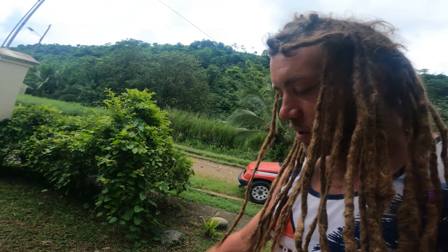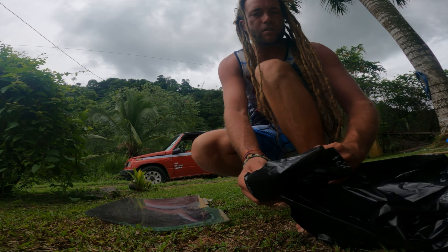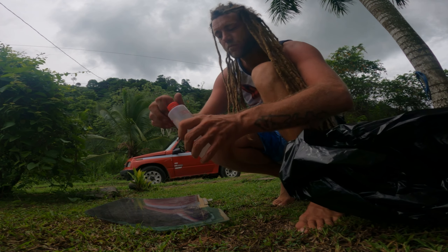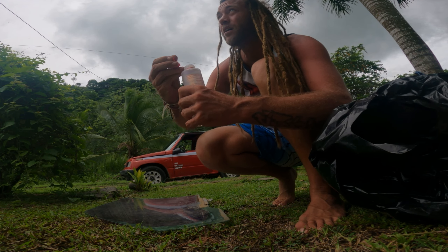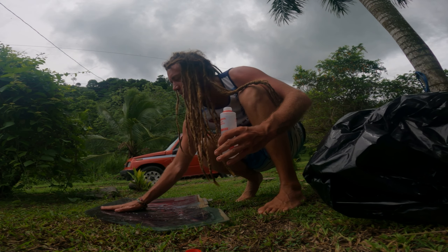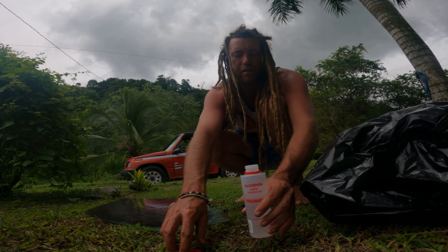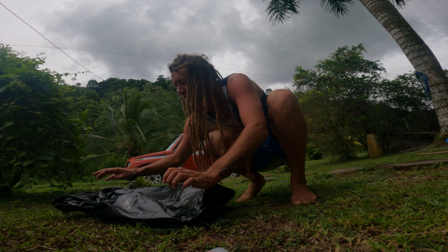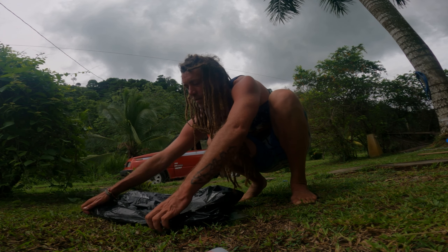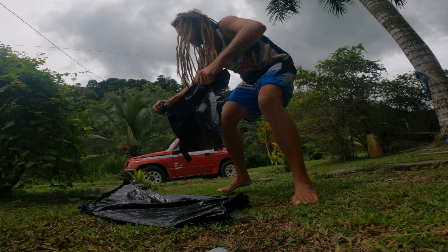The top is on. Now it's time to work on the inside. I gotta get this window put back in, but first I want to get this tint off. Something I learned way back in the day but never tried — take some alcohol, let it sit in the sun, and pour alcohol on top of the tint. Then take some plastic bags and lay them over top to keep that alcohol down on top of that layer of tint.